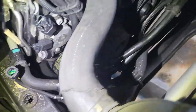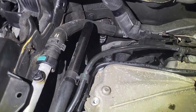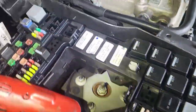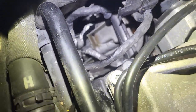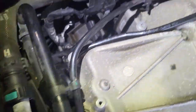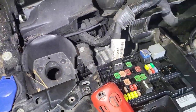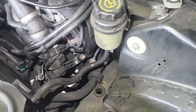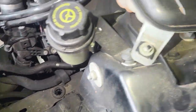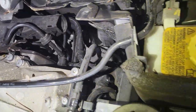Please watch to the end so you have enough information before you remove your engine. We're going to remove the engine from behind here — opening bolts down there and taking out the wiring harness. The engine has to come out with the harness, so it'll be much easier for you to work on it and transfer the harness instead of disconnecting it from inside the car.